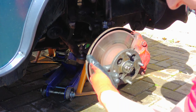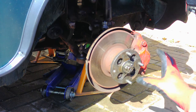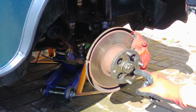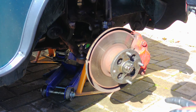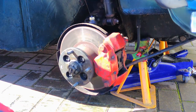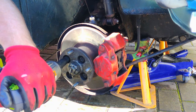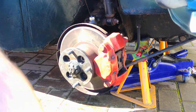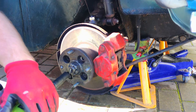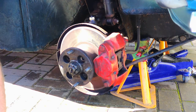It would be easy if you could just knock this out and put another one in, but the space behind here is just not enough. So what I need to do is take the flange off — basically one, two, three, four bolts, split pin and the hub nut here come off — and then once it's off we can get this out and get the new one in. These are half inch bolts and I find it easier doing this before I do this centre nut here. See how good they come out when they've got copper grease on them.